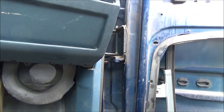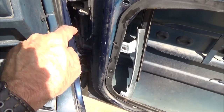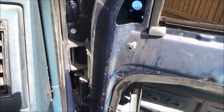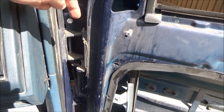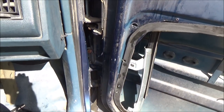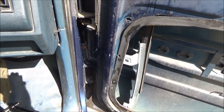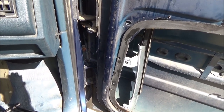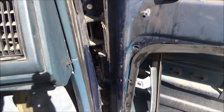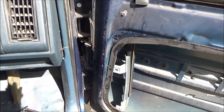Now the fun begins. Very important: the bottom pin installs downward and removes upward. The upper pin installs from the bottom upward and removes from the top downward — which is not the way you would expect it. Just keep in mind that the tops of each pin point to the center of the door. There are two different size bushings — make sure that you don't put the wrong size in, because once you put these things in, you don't want to pull them out and reuse them. They're brass and they can crack; they're very easy to damage. One set goes on the actual hinge on the body, and then one set actually goes on the door part — they don't go in the same place.